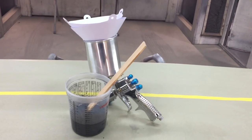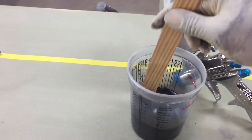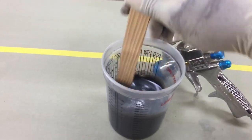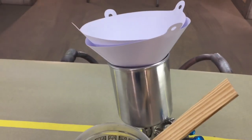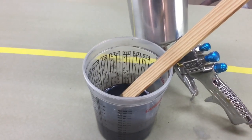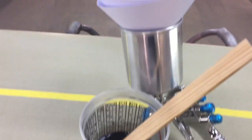So I have my paint gun here. I'm not going to actually pour this in my paint gun just because I'm doing this for the video — I'm not actually getting ready to spray anything. But now that I have my mix mixed up, I'm just going to mix it up and stir real good. Once I've got it thoroughly mixed, I will pour into my filters and filter the paint into the gun, making sure I'm keeping out any dust particles, debris, anything that could have been in the cup if I was using a bad or dirty cup. Try to filter out as many contaminants and particles as I can. And that's how I mix my paint.